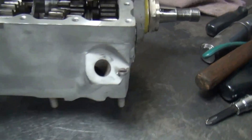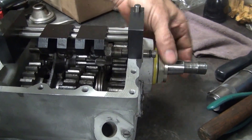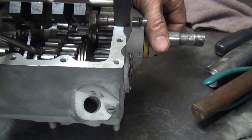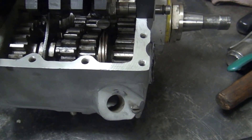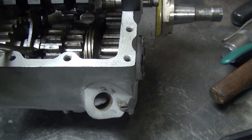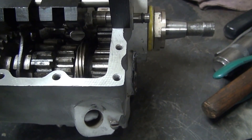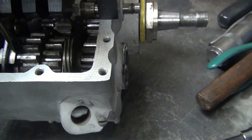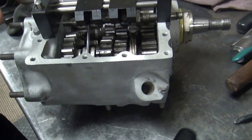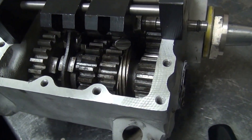And you look at your shift forks. See your dogs right here? Okay, we've got them all three lined up. See, everything has clearances in here. So make sure you push everything in this direction - see how it almost touches? Now you push it all the way the other way and see how you've got a big gap there. So this fork needs to go this way, half of that gap. You've got to go this way a bunch - we'll give it like two washers initially. It'll probably take like three, but we'll just do two first shot.